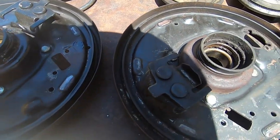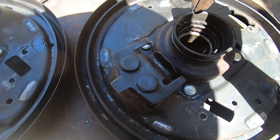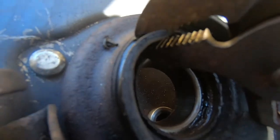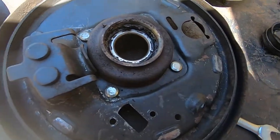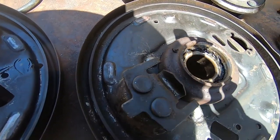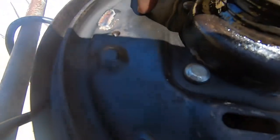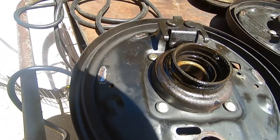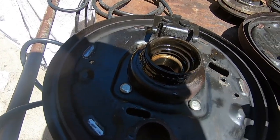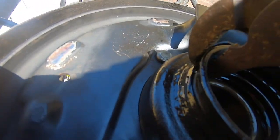Okay, so we got both of these collars off and we're gonna pull the seal off of this one. Then we're gonna push these bearings out with a socket and hammer. You can see there's a sort of bend right here, so we'll use the press to fix that — if not, we're gonna have to go buy another axle. Hopefully we won't have to, but it is what it is. Buy the right tools and do it right the first time.